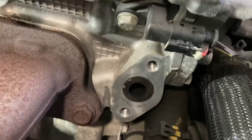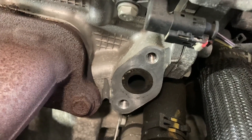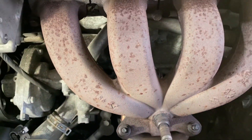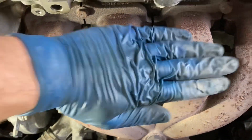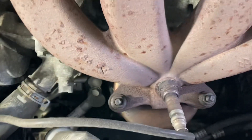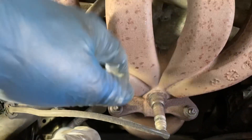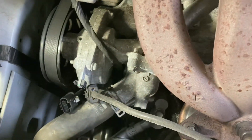That is the port where air is allowed in. Now the manifold is exposed — this one's still a little hot so I'm going to let it cool down. You actually don't have to remove the oxygen sensor; once you unplug it, you can just feed the pigtail through the heat shield.